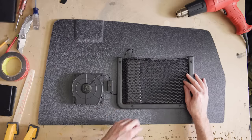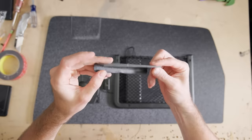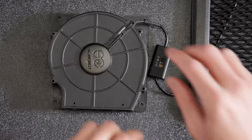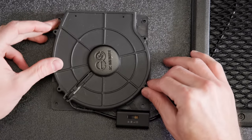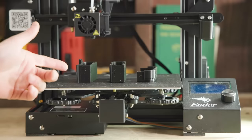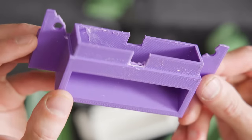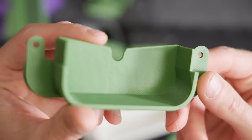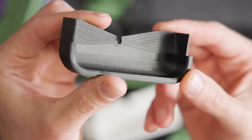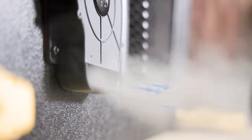The next challenge was to redirect the air — right now it's shooting straight down, but I wanted to aim it in so I can actually feel the breeze. You could curl one piece of ABS up and glue that on, but I thought that looked a little too DIY. I decided to learn a new skill and figured out that if you can print on a regular printer, you can use a 3D printer. The tricky part is designing the models, but I'll give you those for free in the description. After a few iterations, I eventually landed on this little scoop that plugs right into the fan and stays put with just friction, and you can see how the air is redirected with that scoop.